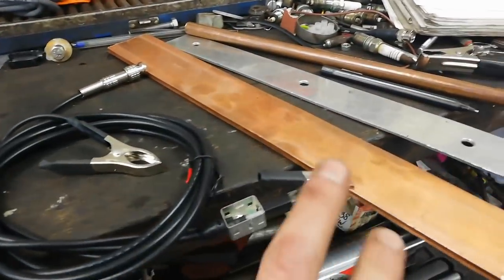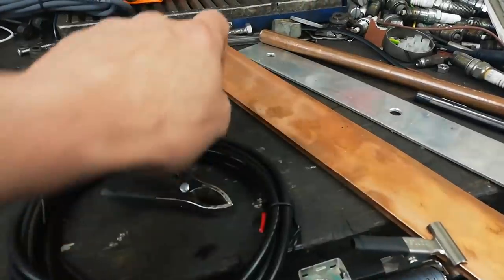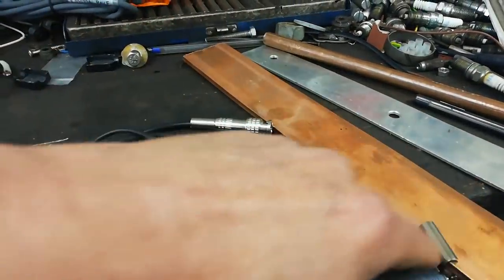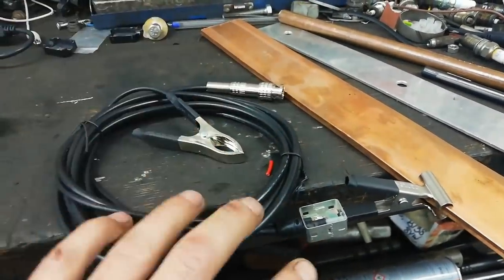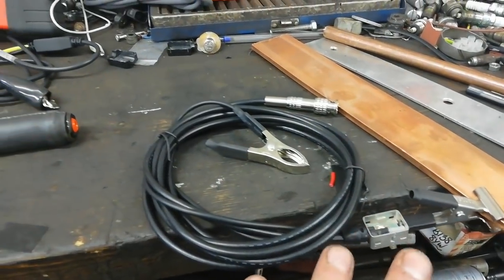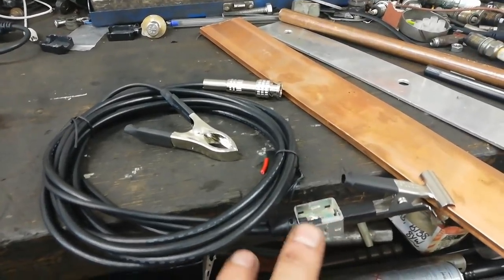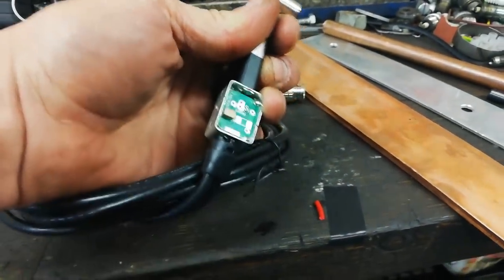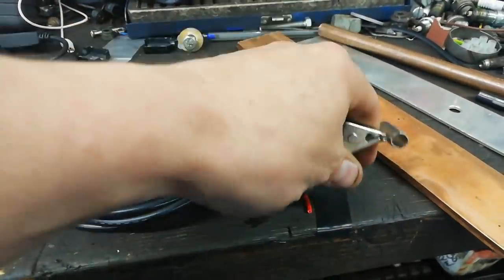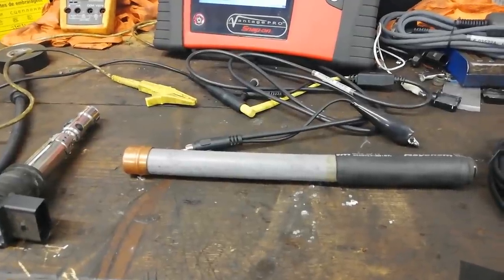I'll point out that this other lead is directly connected and is one-to-one in your scope. These probes are described as 10,000 to one, but it's a 10,000 to one decay - what it's referring to is that it'll dissipate 10,000 volts across that capacitor with a decay. We'll give this wee paddle probe a test on the car and see what kind of output it gives, to see if it's worthwhile making one of these.